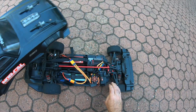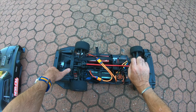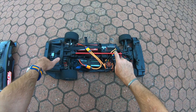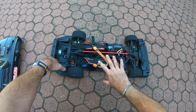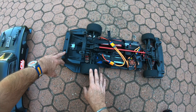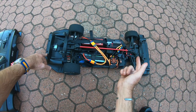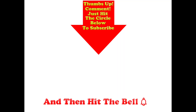Doesn't smell a lot. The motor is a little bit warm but that motor is only a 6s one, and I have a feeling I should put the Power Hobby turbo fan on it to keep it cool if I'm going to try it on 8s. I've got a couple of 3s packs in there so I will first try it out on a speed run on 6s, and then give it the full beans on 8s. On 8s it's an absolute handful, but I do want to preserve these tires for the speed run since nowhere is selling the Arrma Felony tires at the minute. If you like what you've seen today, don't forget to like, share and subscribe - thanks for watching.